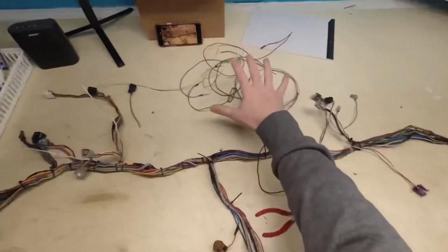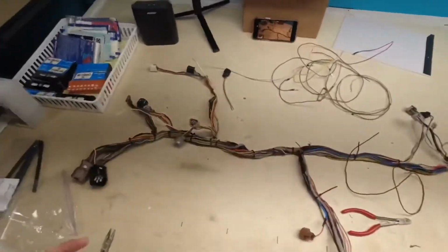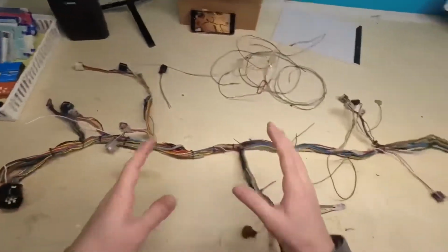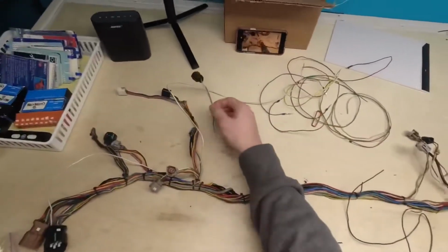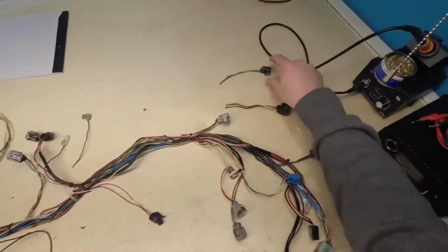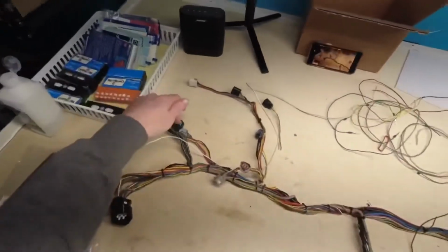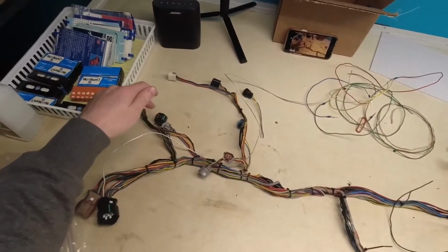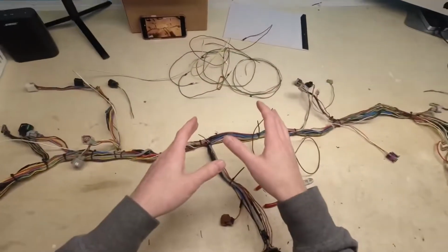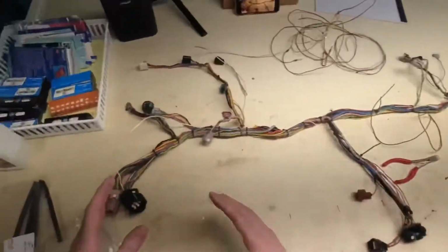Okay, so you'll see this pile of stuff here sitting over there when the video transitions into the clips I didn't delete. But what I did is I laid out the connectors and I put one wire back. So essentially this pile of wires went to the TGV solenoid on the driver's side bank, and it went over to the TGV sensor and the TGV solenoid on the passenger side bank. Now again, we're keeping the TGV sensor over here because that apparently is going to be used as an ethanol content sensor input. So we left that alone, but all of these wires except for 2, again, that you'll see when it transitions into the clips I didn't delete, went to this connector here.